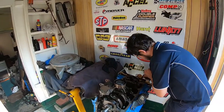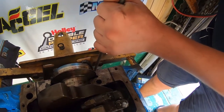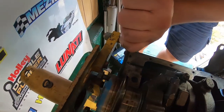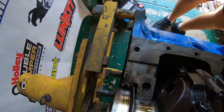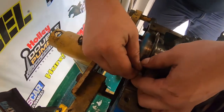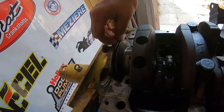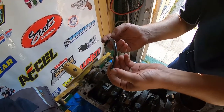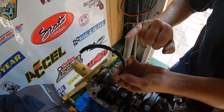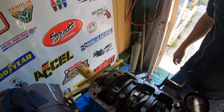If they leak, they come out easy. If they were dry, they won't come out easy. Now this one's coming out very, very easy. In a couple of seconds I'll come around over here — you should be able to grab the seal and the harmonic balancer bolt and rotate the crank at the same time as you pull the seal out. Yeah, it was leaking. It was in the right way, it was just worn. If I had left this in there it would have caused the next guy a bit of an issue. It's really good to see bearings in that condition — someone's going to be getting a bargain when I put this back together.